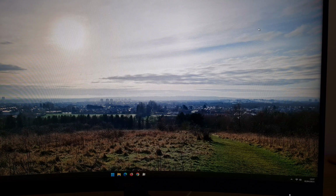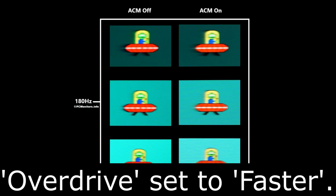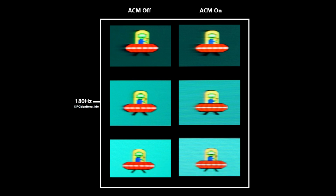In addition to giving an image which is more muted and more appropriate within the constraints of the sRGB color space, and some may indeed prefer this look, using sRGB emulation can also speed up some pixel responses. It doesn't do this universally, and it very much depends on the content as to whether you'll actually notice this or whether this will be an advantage for you.